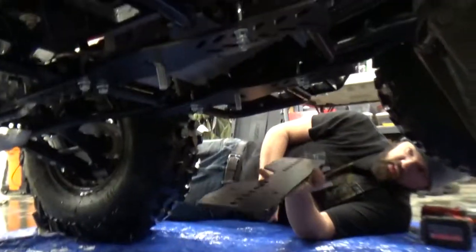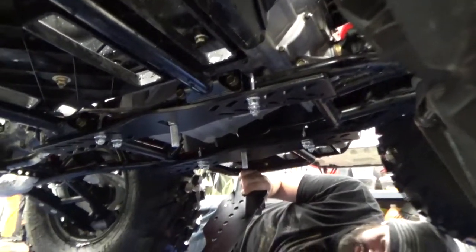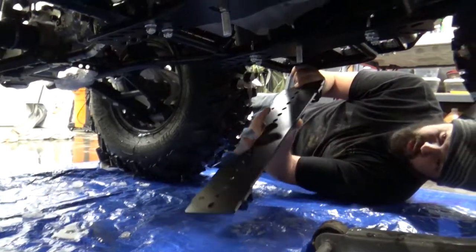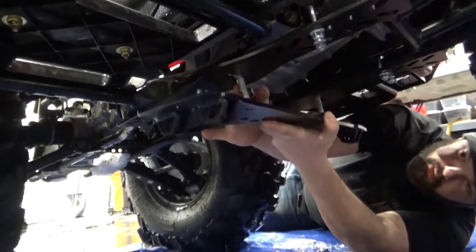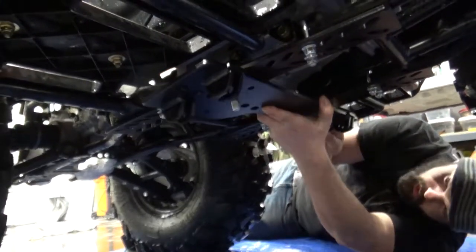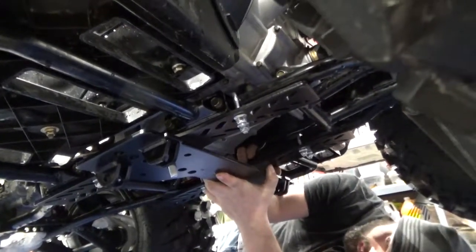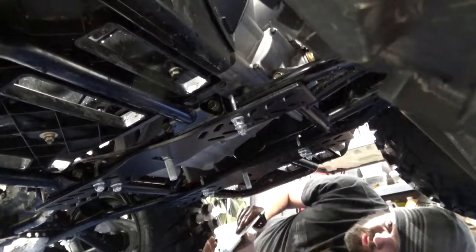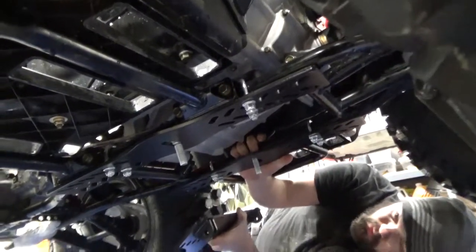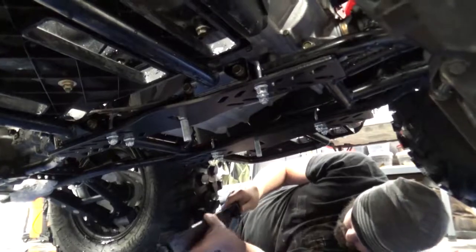The cutout points towards the back of your quad according to the instructions. This crossmember actually has multiple holes drilled in it for different widths of your frame mounts. We're going to try to aim for the third hole and get it looking uniform. If it doesn't fit, we'll loosen the U-bolts and slide the bolts around to adjust.